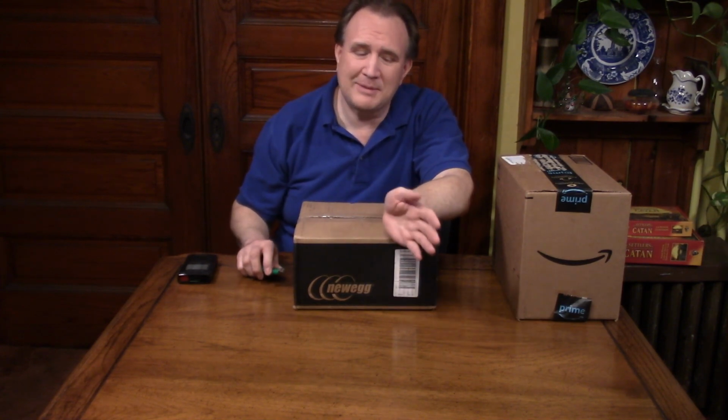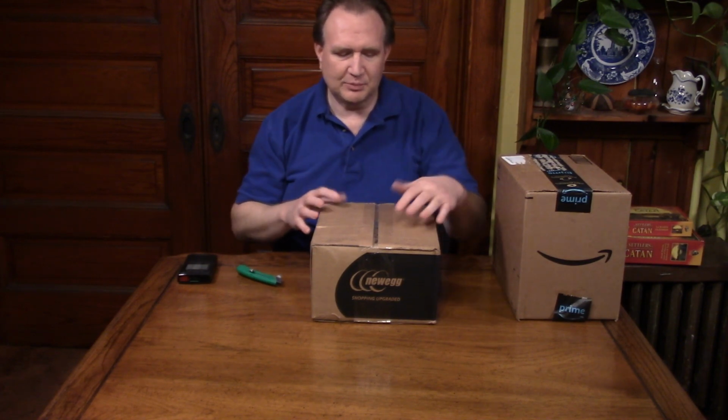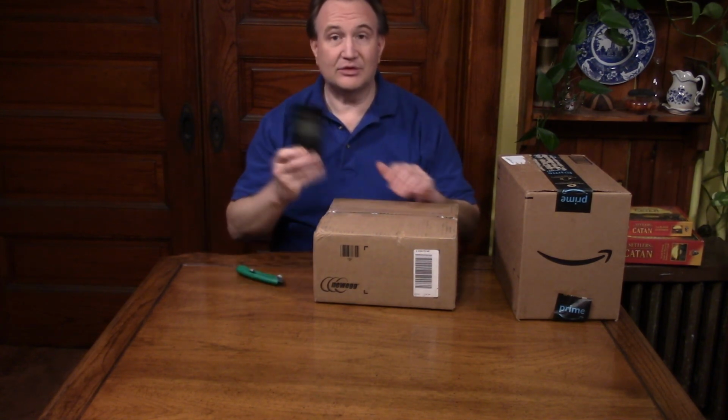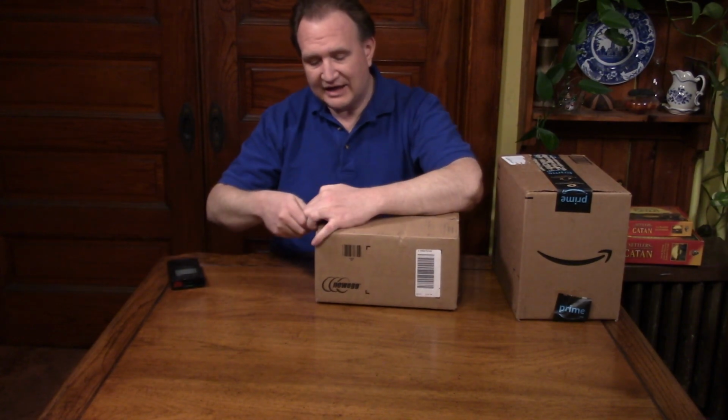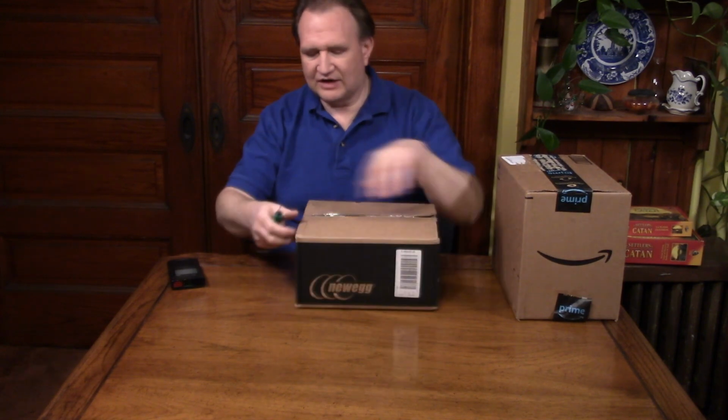And I was thinking, maybe it's the power supply, but it's probably not the power supply. Maybe it's the motherboard, maybe it's the RAM, maybe it's the processor. I extensively tested the RAM. The processor, I didn't think it would be that. I didn't think it'd be the power supply, so I thought it must be the motherboard. So I was going to replace the motherboard, but I did also order a power supply tester. And the power supply tester indicated that the power supply had a problem with its 5 volts. So that's what was causing me crashes.